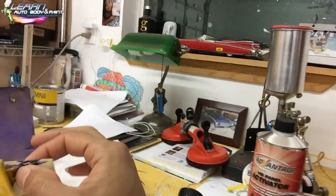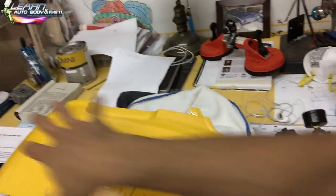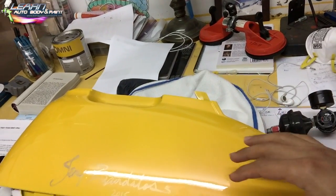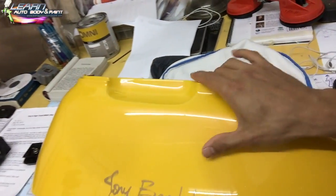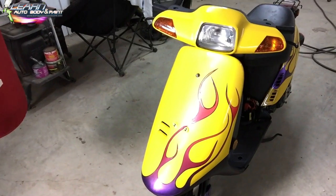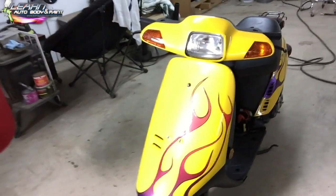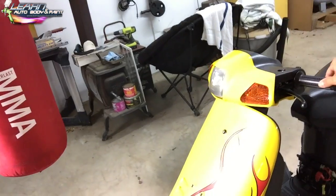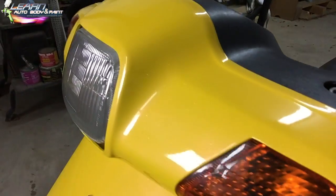I'm epoxying this tab so I can put the panel on tomorrow. For the paint, I did yellow with a red pearl, a little bit of gold pearl, and silver flake — and I even signed it, put my name in there. The Advantage Clear is pretty good, has a nice gloss. We'll see in a week how it looks, but if it needs a buff we can water sand it with 2000 grit lightly and buff it out. In the sun this thing looks mean — you can see the red pearl in it.